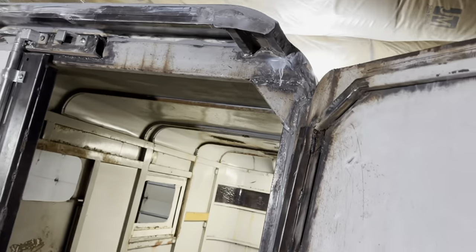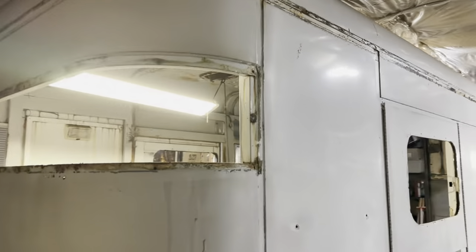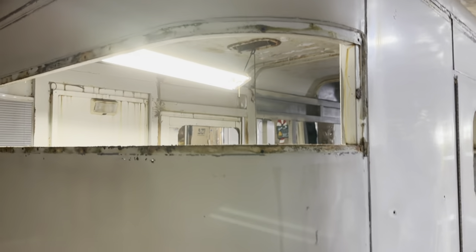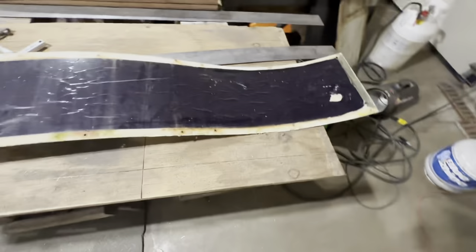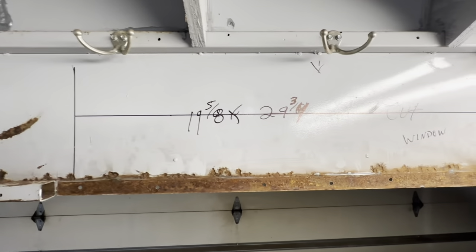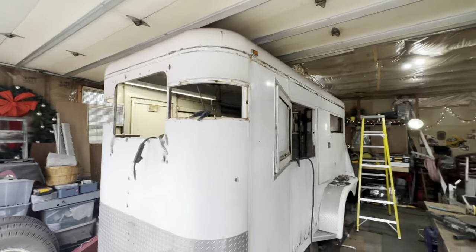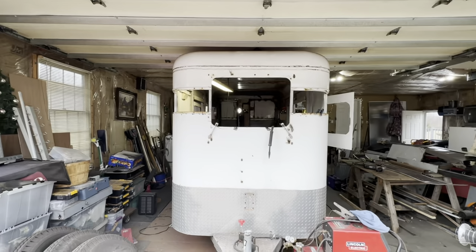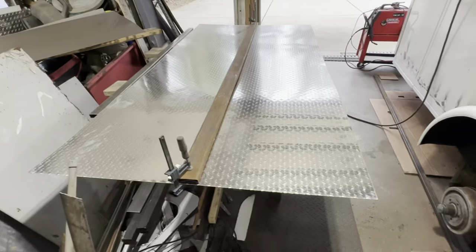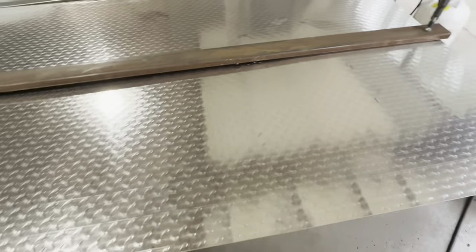If you look at these doors, everything he made here — he welded everything up. The door did have a divider in the middle originally. This is the front of the trailer. Originally there was a piece of plexiglass here that was tinted and they actually painted over it so you couldn't see through it anymore. Steve wants to put a window in here, and looking at the measurements, he did cut the window out and framed in new metal to support it. Around that, he wanted to put diamond plate to make it look like it came from the factory that way. It looks fabulous once it's on there.